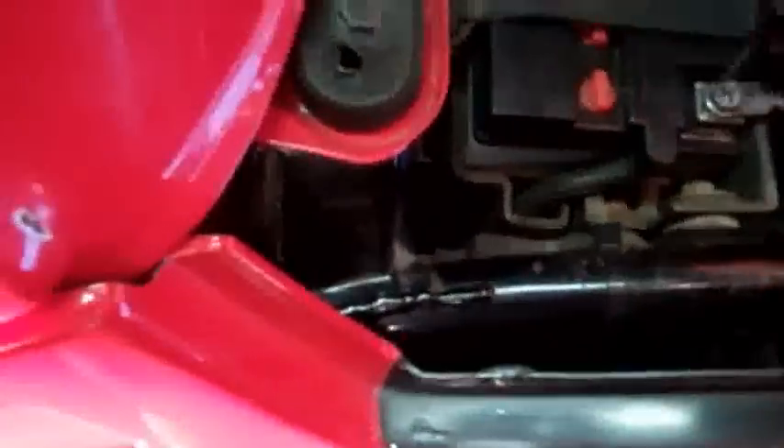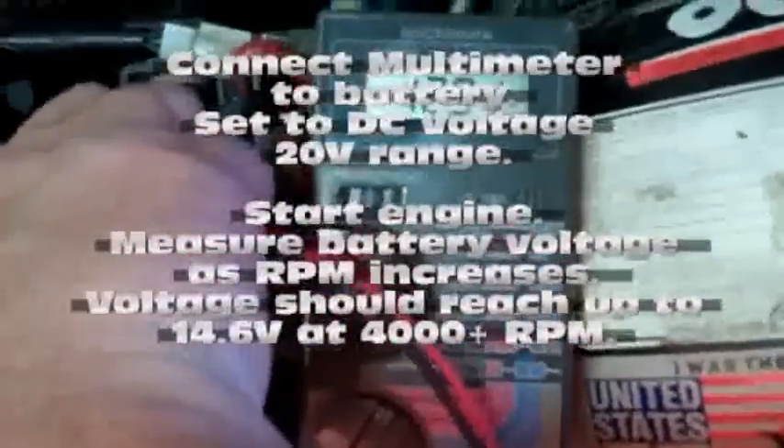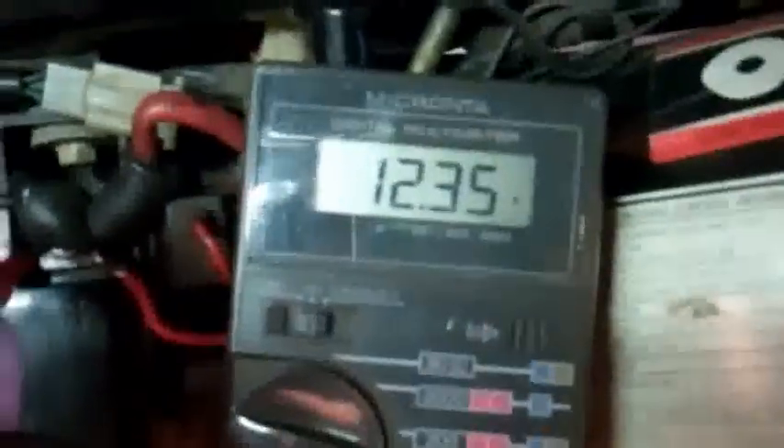Okay, we're all done. The cover is back on and the clutch hose is tightened up and moved back into place. Let's do a quick check and make sure we're charging the battery. We're going to take a multimeter — go ahead and take your seat off so you can get to the battery — hook up the multimeter, measure battery voltage, set to DC volts, 12 volt setting. A good battery reads 12.9 volts. We're going to key on, run, and then rev up the bike to about 4,000 RPM to make sure we're charging.